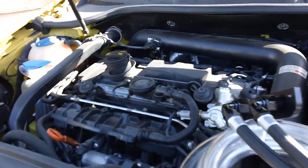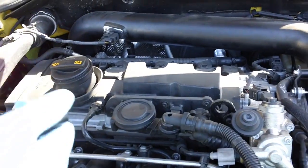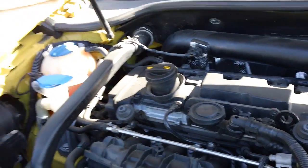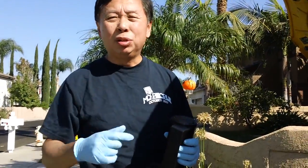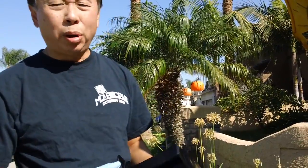It's really a replacement of your PCV valve. Your PCV valve takes the over-pressurized gas and oil and pumps it back through your intake system. But what happens is that when it's going through your valves, since it's direct-injected, there is no gasoline to clean those valves off. And after a while, they're going to get all gummed up with oil.